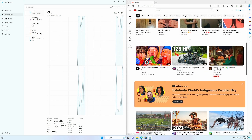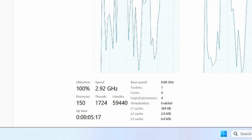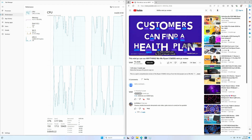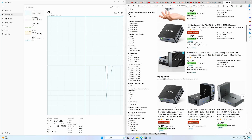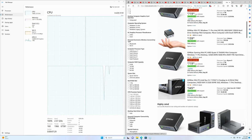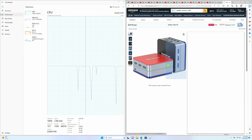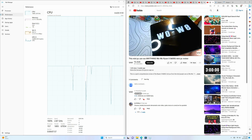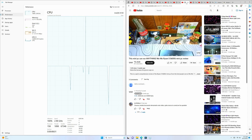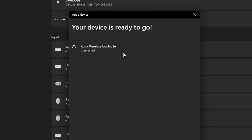Starting with browsing — we have 12 gigabytes of fast RAM so we won't be bottlenecked there, but the processor could be the limiting factor. I opened a YouTube video and duplicated it about 10 times. You can see the CPU utilization jumped. This wouldn't be as much of an issue with a hyper-threaded processor — four cores, eight threads instead of four cores, four threads. It can multitask, but it's optimized for lighter workloads. Split view with a document and video is fine, but streaming or video encoding are out of the question. The unit also has Wi-Fi and Bluetooth, so you can pair wireless Xbox controllers, headphones, and more.